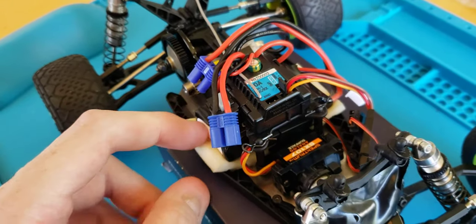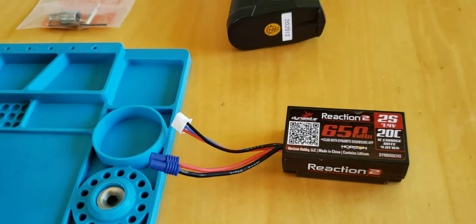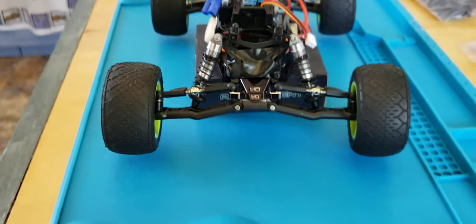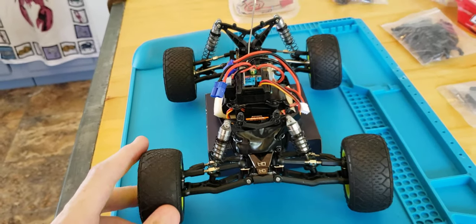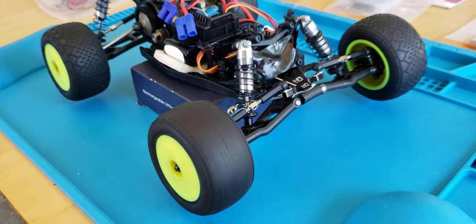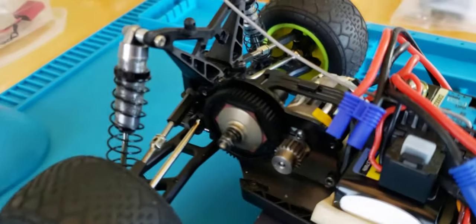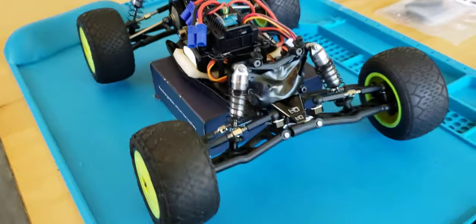I'm running an Electron 860 little battery, 25C — the stocker. I don't notice any difference. I thought a 25C 860 would run a little bit longer — the 860 milliamp compared to the stock 650 — but not much of a difference. So I decided to give my car a little bit more toe in and a little camber. We made our track nice and tight and she started doing a lot better. I put a little bit of Singer sewing machine oil where all the bearings are and they just glide nice and easy.